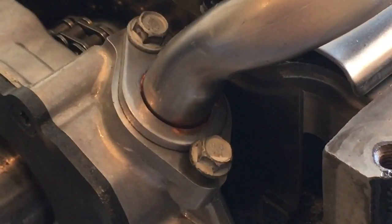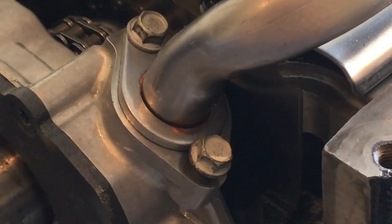As you can see right here, I have the pickup tube installed that matches the GM muscle car pan. When I first screwed that in, I thought, well, if I had a spacer to take up that space below, and then maybe a slightly bigger washer, I'd be happy with just putting a washer on that side.